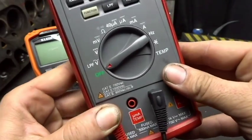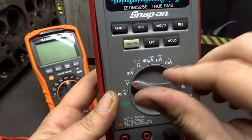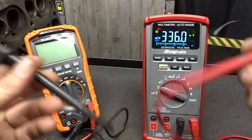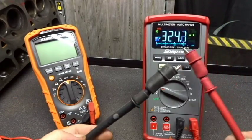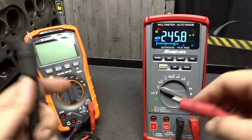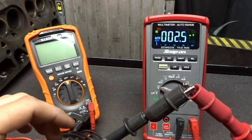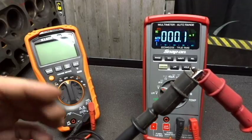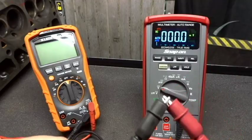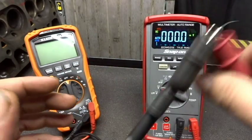If you're testing for amps, you would leave the black one on COM and move this over to amps. But for right now let's go back to COM. Now if we go to volts DC, you'll see we're all over the place. We have things like frequency of lights, radio towers, power antennas, and things of that nature — so there's going to be some noise. The DVOM can't settle until it has some kind of direct path. So we're going to connect the two test leads and see if things settle down to a ground voltage, ideally complete zeros. You can wiggle your leads back and forth to see if there's anything occurring within them, maybe a frayed wire or something that got bent or pinched that might be causing a different or weird reading.